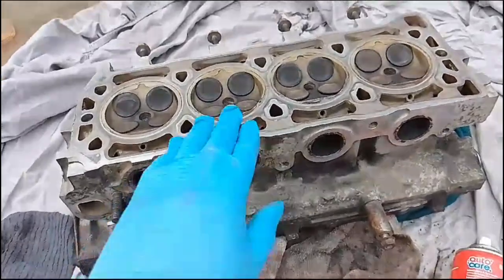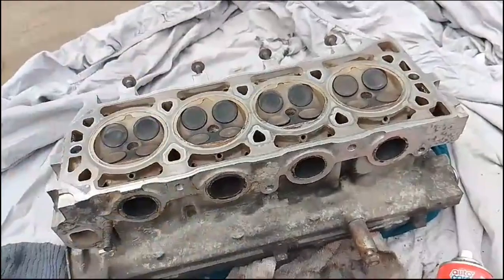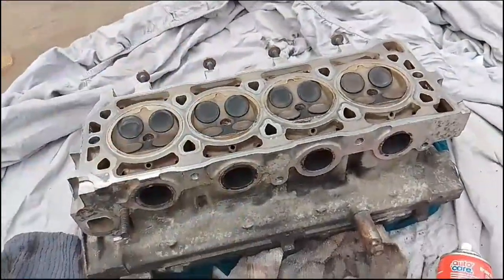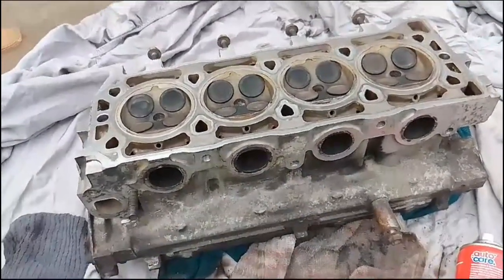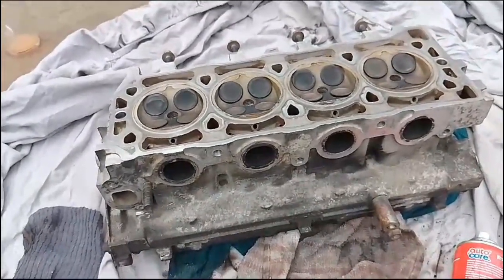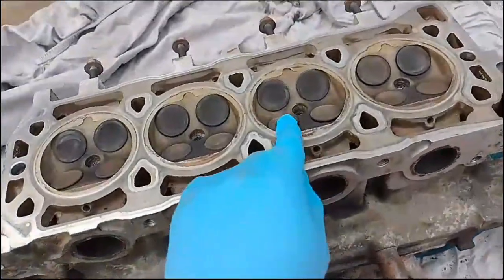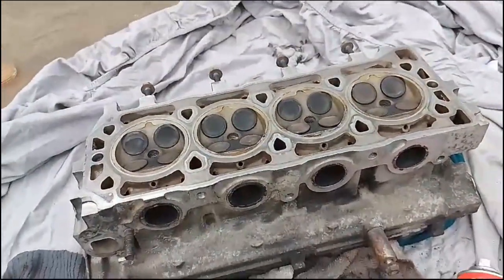But you could purchase a complete block that isn't tappy and fit another block to it in the future if whoever has the car wants to. But yeah, that's just a bit of knowledge for you as to why you're getting the tapping sound. It's not anything to worry about, but at the same token it's not ideal. But once these are adjusted down, that tapping noise will disappear.